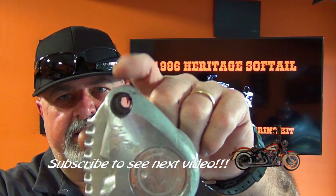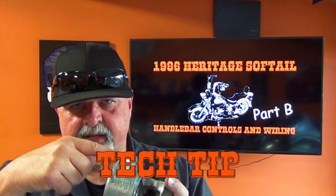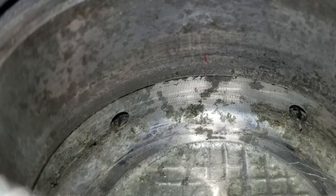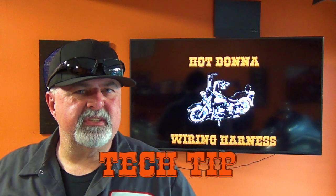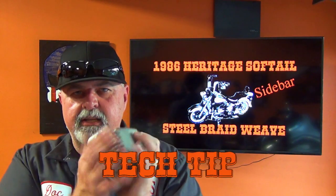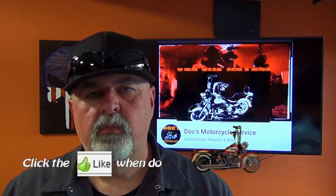Tech tip: I cleaned this up with brake cleaner because it's under pressure and does a lot of good things. You see that eye — nice and clean. I took that brake cleaner, put the little straw down in there, and sprayed it out real good. Where your brake line and bleeder valve come in, there are two little holes. I stuck the straw in from each side and blew it out the reverse side. This stuff comes out like snot, and you don't want it to dry and clog those holes. You're cleaning the anatomy of it — where the fluid flows.